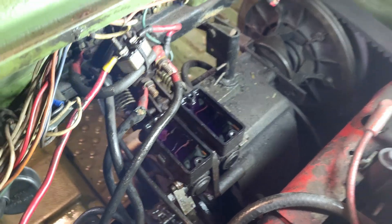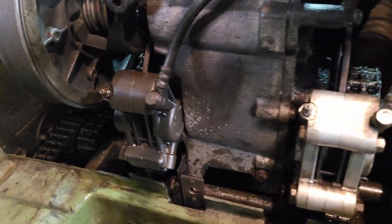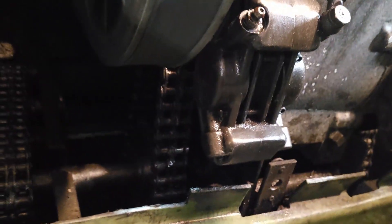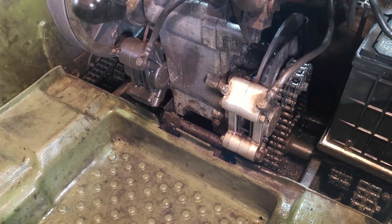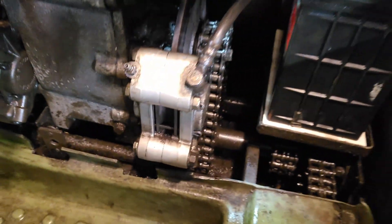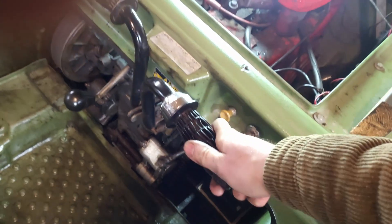I made a little discovery while testing the brakes. I cleaned up both calipers, and notice that they are not the same — if you look at the heads, this one has hex bolts and that one does not. So one of those isn't original. I'm guessing the one on the right, because it's shinier, is probably the replacement, and the one on the left is likely original. And to further corroborate that, there are nice new brake pads on the replacement one. So at some point that caliper has been replaced, which is fine — it doesn't bother me at all.